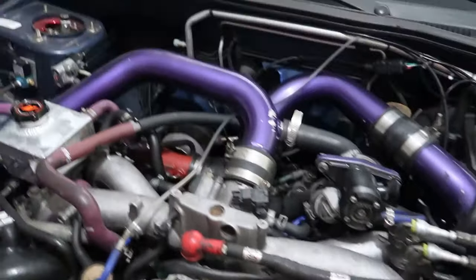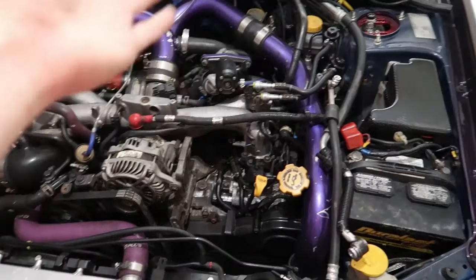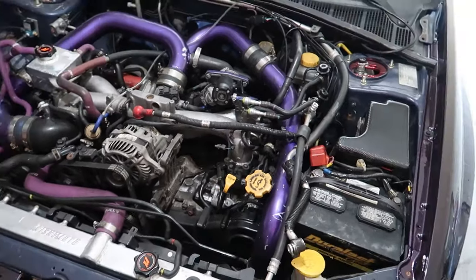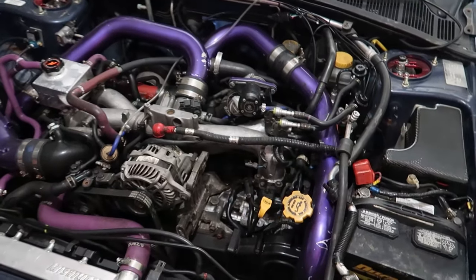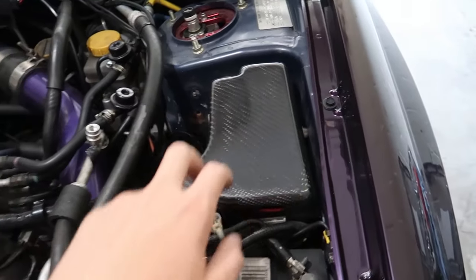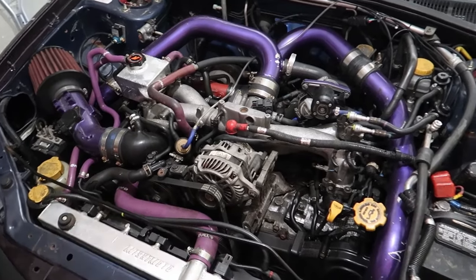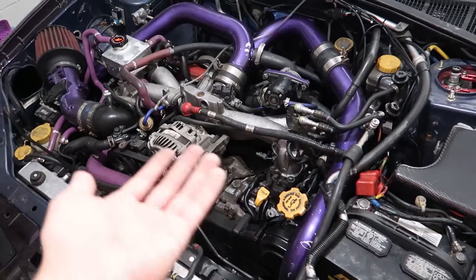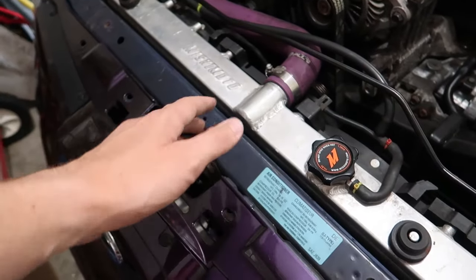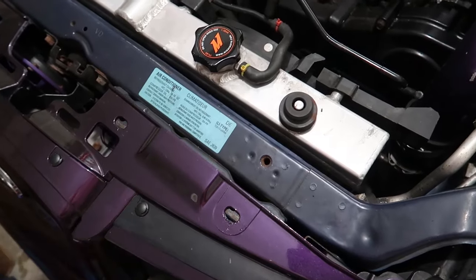The other big thing is my engine bay is still blue — it wasn't resprayed because my engine wasn't pulled when the car got resprayed, and the engine bay was never really a huge focus for me. This winter I will yank the engine and redo the engine bay — maybe tubs. You have to relocate your battery and fuse box; it's a huge hassle. Right now I kind of just want to get the engine bay slowly working, so I'm going to prep the radiator brackets to be painted as a trial run.